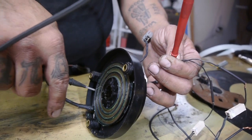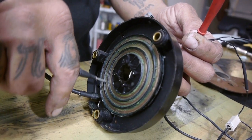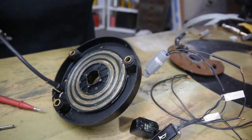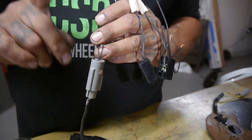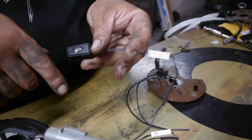You won't get continuity anywhere else because it's not connected there, so that's going to be where our horn ground will be. I'm using the original relay for the horn relay that was on the original harness we did on Reckless. I'm just feeding the power — it's already there. All we need is the ground interrupter. Staff Sergeant Reckless is a 1993 Fox body GT. I cannibalized our other setup. I also wanted to apologize — I mentioned in the last video you could buy these horn buttons on LMR for 60 bucks, which you can.